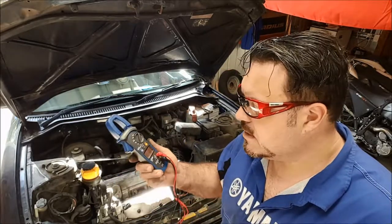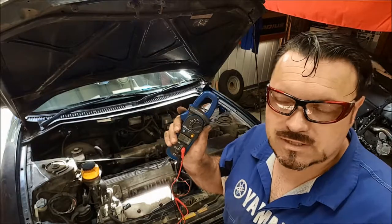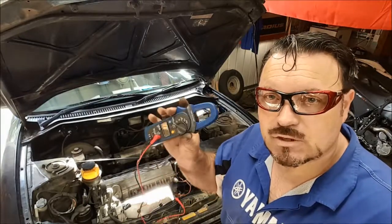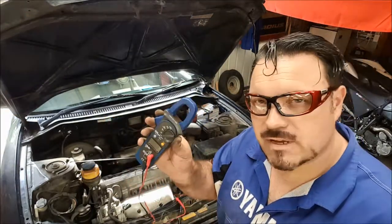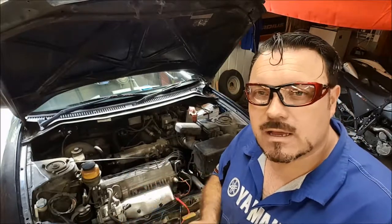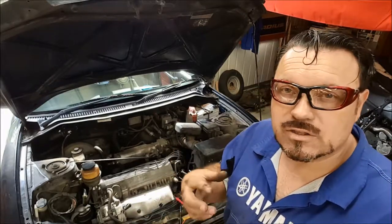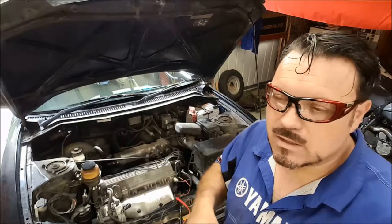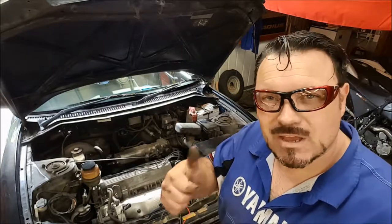Using one of these meters — the Limit 21 — very, very useful. Not only is it an induction type ammeter, but we can also use it for testing resistance, continuity, and voltages, just like a standard multimeter. It really is a little multimeter but it also has the benefit of the clamp inductive ammeter — and in one unit it does everything I need, especially with the duty cycle feature too. My name's Andy Young. I hope you've found this informative. The next part of this video will be taking a starter motor apart, looking at the solenoid and the internals of the actual motor itself — the commutator, the brushes, the pole magnets — basically everything inside a starter motor. Thanks for watching.